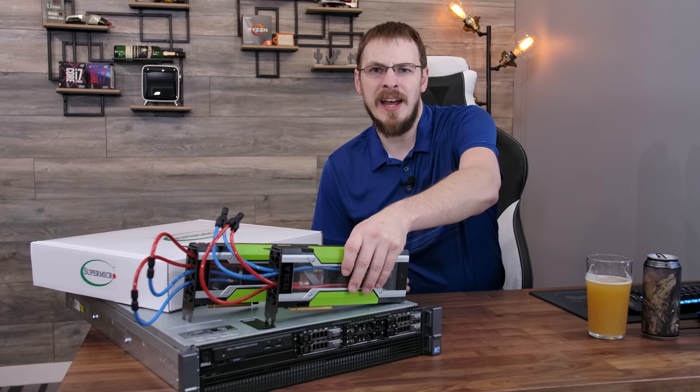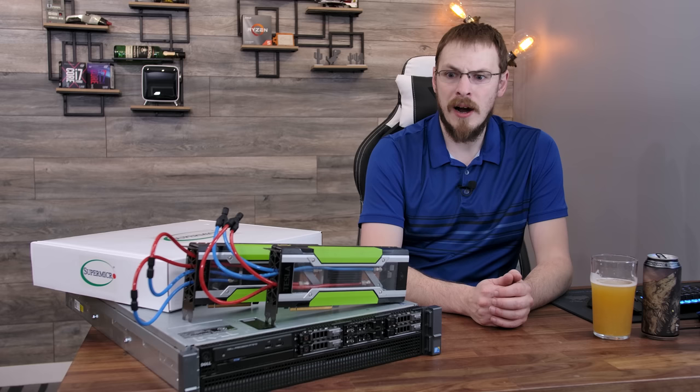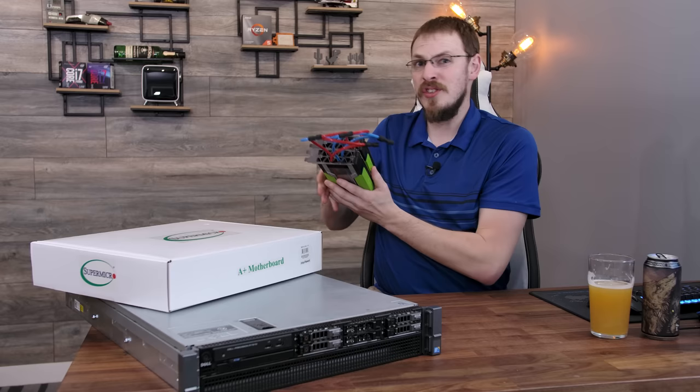These cards can also draw just a little bit more power than before. Where a Grid K2 would cap out at 240 watts for the entire card, these will cap out at a full 300 watts, giving us much, much more power to work with when we're talking about virtual machines and GPU instances. But we're not quite ready to talk about these cards just yet, so make sure you're subscribed to the channel so you don't miss that future video.